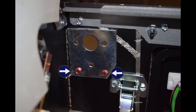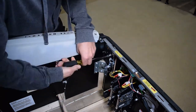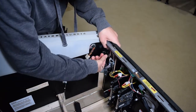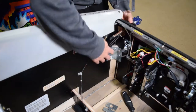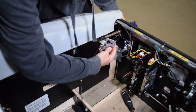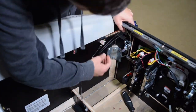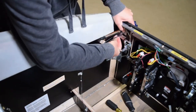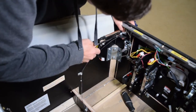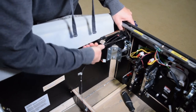To remove the shooter plate, you need to remove the two screws located here. Use your nut driver and remove the two screws at the bottom of the plate. Next, slide the lighted shooter rod housing into the pinball machine and put the base plate into position. Make sure to route one wire on each side of the new base plate before replacing the two screws at the bottom of the base plate. Make sure the wires are not getting pinched before you tighten down the two screws.